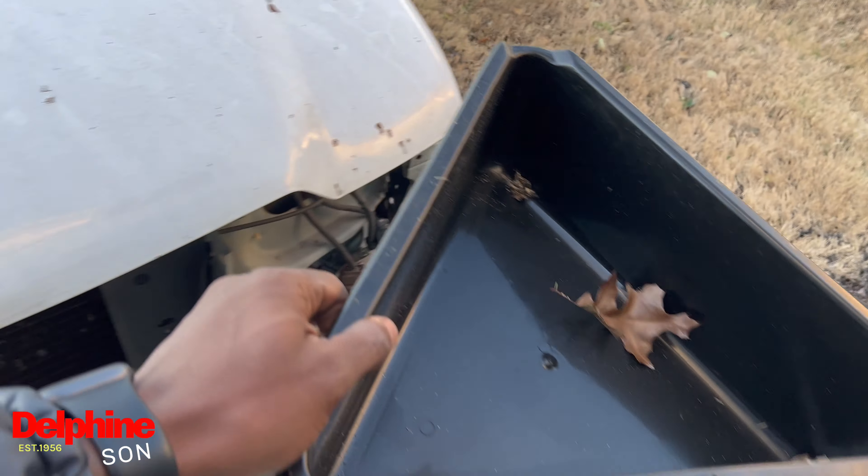It really ain't that hard to do, you just need your little drain bucket. I actually got one right here — y'all seen a video before where I picked this up from one of the ATV stores. Now it might get a little messy, but what I'm gonna do is take a line off this carburetor. That still ain't gonna clean all the stuff out the bowl, but most of that old gas will be out and there probably ain't that much in it to be honest. These bikes ain't been started in months.